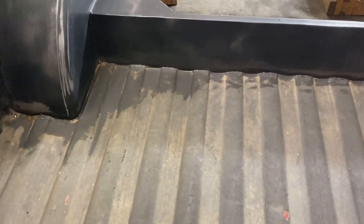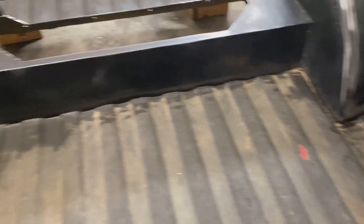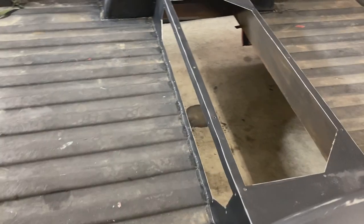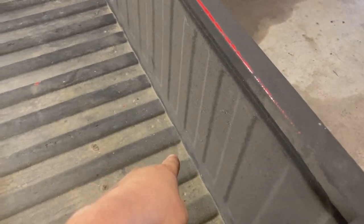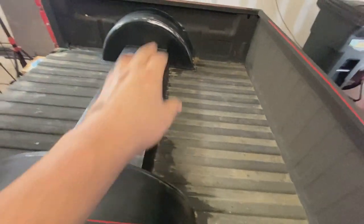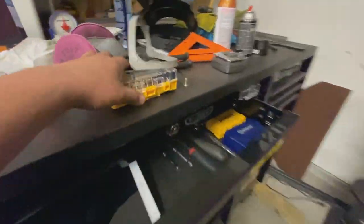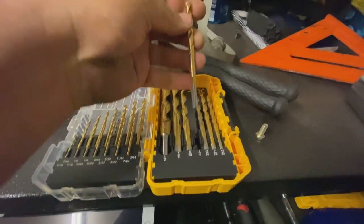It's already looking like it's starting to rust through. We want to try to prevent more of that - though it's probably too late now because rust is pretty hard to stop, it's just going to continue to rust. So I'm going to go ahead and drill some more drain holes on this side. The back of it is not going to be too much of a big deal because it is open on that side, so once he drives it'll all drain back there. If I don't do the holes in the back, I'll probably end up doing them in the front. But since the truck is going to be sitting at an angle, the water is going to have more of a tendency to pool up in the back. I'll go with a quarter inch drill bit.